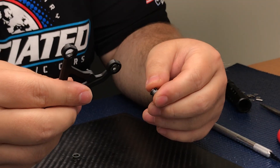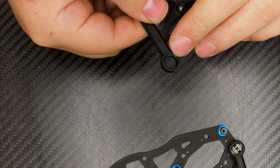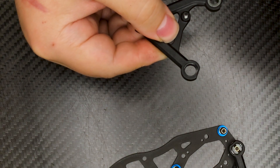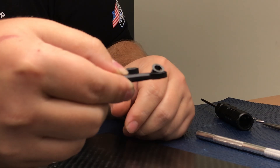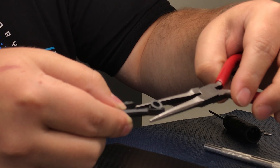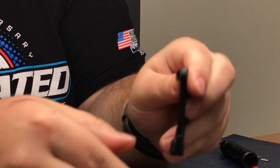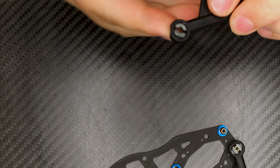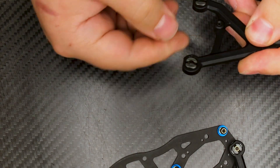Take your arm — I already have one pressed into this arm with the two screws from the first step of the kit install. You'll see two orientations: one side has two notches, the other side has just a cylindrical face. Take the lower ball insert and set it in on the notched side, sitting in just like that. You have two options to press it in: needle nose pliers on the edge squeezed together while pushing down from the top, or you can use your thumb and the top of your hand to do the same. Press it in and push down from the top. Sometimes the insert isn't seated perfectly straight, so just squeeze down on top and rotate it easily to correct that.